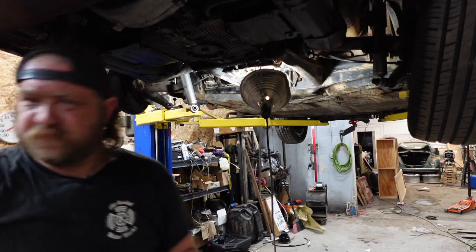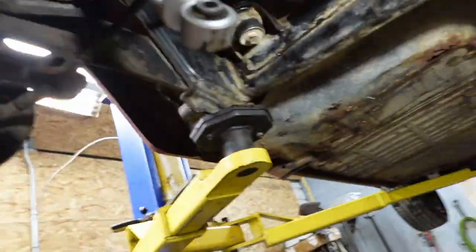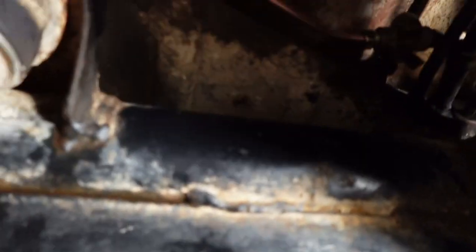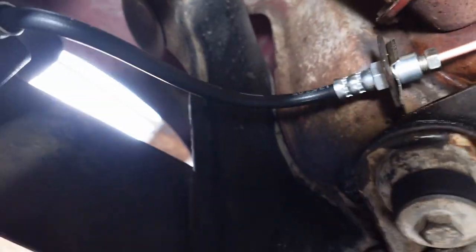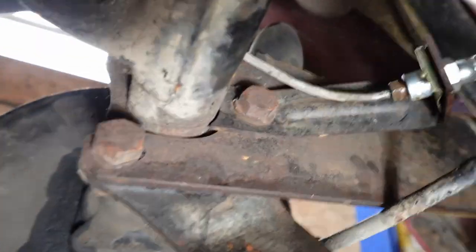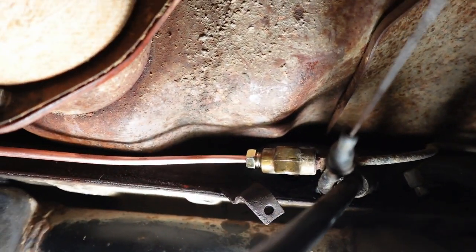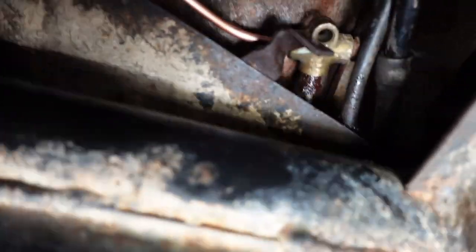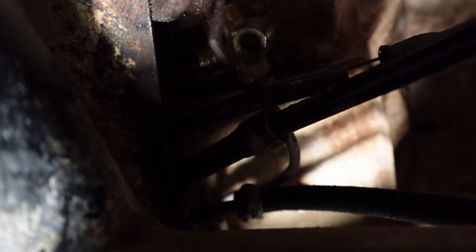Definitely recommending, yeah, I know you couldn't see what I was doing the whole time. Oil compressor. Definitely recommending new steel lines. But yeah, new hard line, all there, new soft line actually in the bracket. That hard line looks fine, we're leaving it. All those metal lines, they're super corroded. And that distribution block is at a weird angle. And you can probably tell that it's also corroded in there.